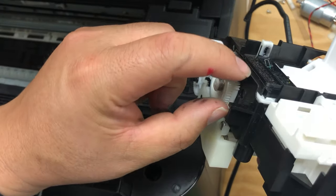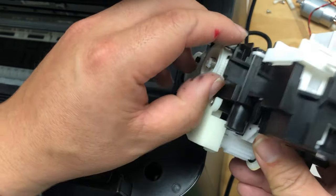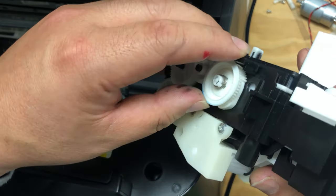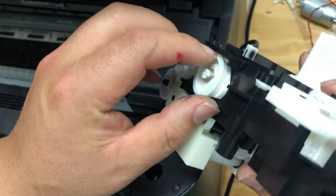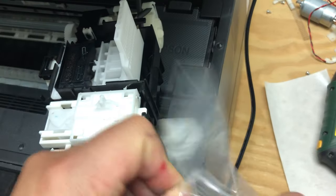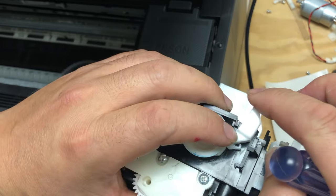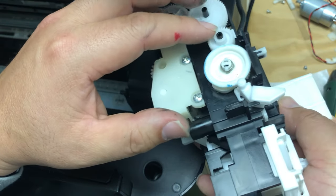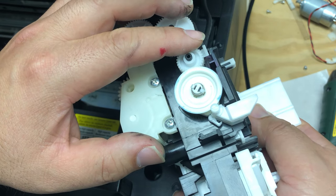The lock is right here, and it is controlled by those two gears. If you see the bulge on the bigger wheel, that bulge is what pushes the lock into position to lock the print head. When you buy from BCH, you get a lock and you get a little spring. The spring connects those two hooks so it can put the lock back in the unlock position.